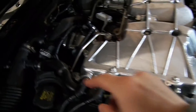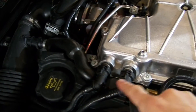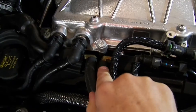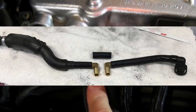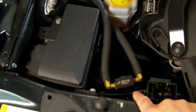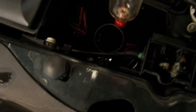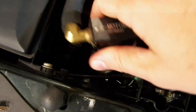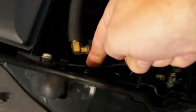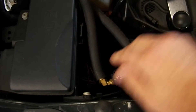Here on the left-hand side of the car, we can follow the hose from the intake around this path. And here you'll see where there are two elbow joints that were added. This is where the catch can is, and I was able to mount it to the sidewall where there's a convenient place to hang it, with a threaded hole — an M6 to hold the canister.